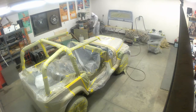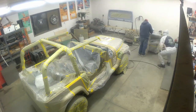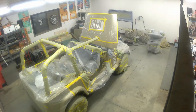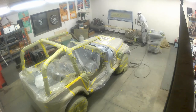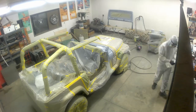I'm hitting the windshield frame with primer sealer front and back, and I'm going to hit the top of the Jeep where the air vent is with some primer sealer. A little overspray on the desert sand part - that's okay because red is going on soon. I'm going back through making sure I got everything I wanted to hit, and then we're done and we're going to let it sit for an hour.